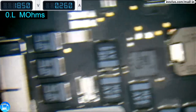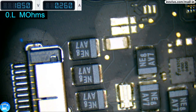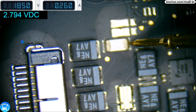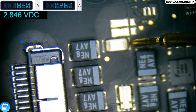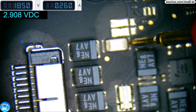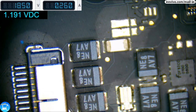In this video I'm also showcasing the OneEye - I already have the software hooked up on the top left. We want to switch our multimeter over to voltage. The OneEye is actually a multimeter reading that's built into the microscope. So we're getting 2.8 volts and climbing - that's not right, we're supposed to get roughly 8. It looks like something is pulling down PP bus.